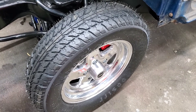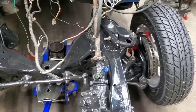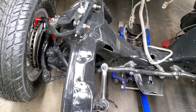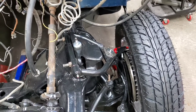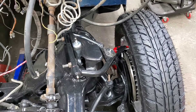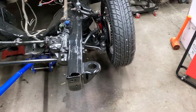15x4s on the 26x7.5x15. After putting this stuff together, I noticed that all the shims didn't go back in and there was no way I was getting those back in, so something wasn't right. These are the Speedway 8-inch arms, and tonight we're going to swap those out for a little bit longer ones, and we're going to go ahead and put a 1-inch taller ball joint in the upper control arm as well.